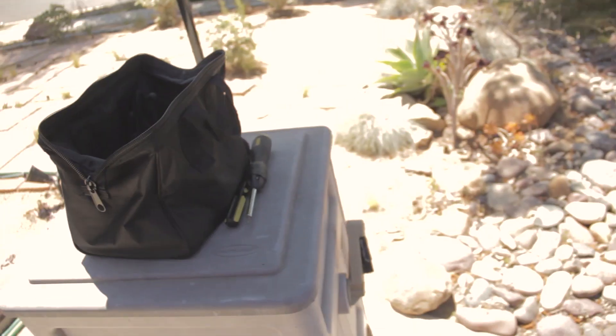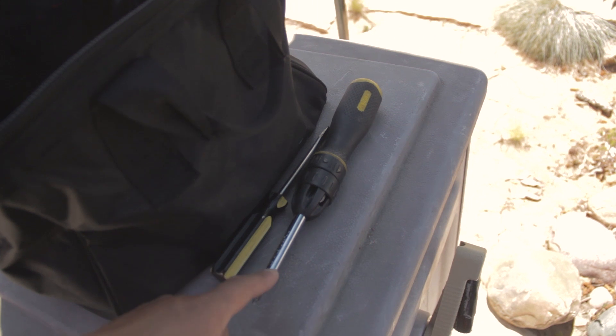Especially because we're going to be adding the ballast for the LED, I don't really think it's practical to go through the wheel well liners. So we're going to take off this bumper, then take off both housings for the headlights, and then replace the bulb with the headlight not attached to the car. To do this job, all you really need is a screwdriver.